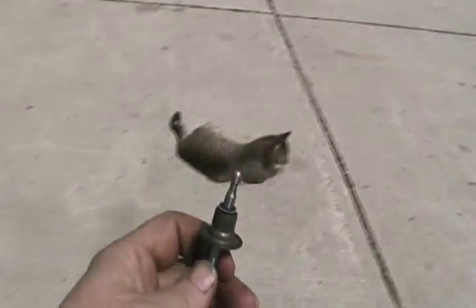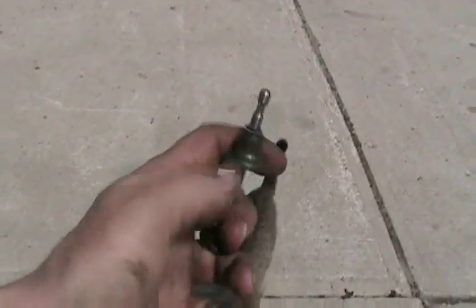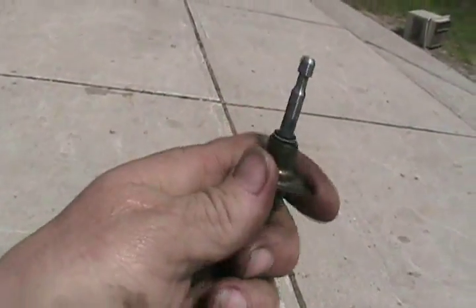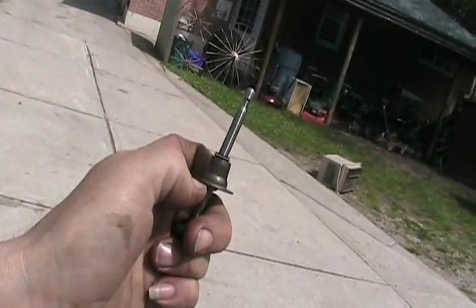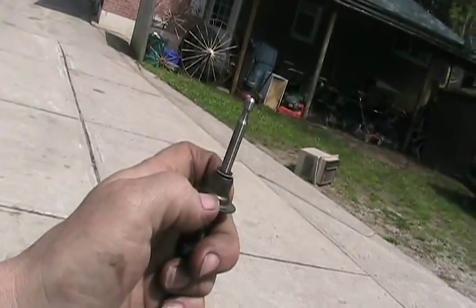On Mitsubishis, they have a problem consuming a lot of oil all the time when their valve seals pop off, or the rubber neoprene gets too hard and no longer grips the valve — like if you took this valve seal off and let go, it would slide down the valve just by gravity. That's a very common problem with a lot of modern cars, especially Mitsubishis of the 1980s. If your car just smokes all the time, you could have a 4.6-litre Ford from the early 1990s — they had really crappy valve seals. They're old rear-wheel drive Fords, and they did that too, not just Mitsubishis.